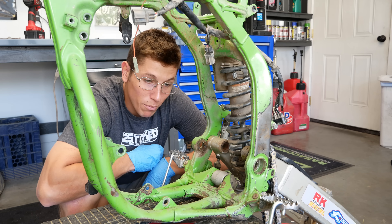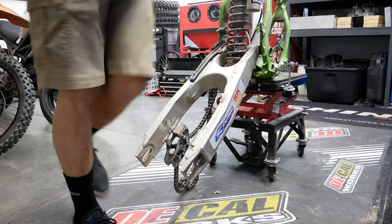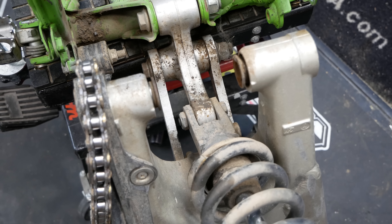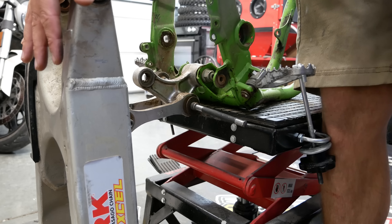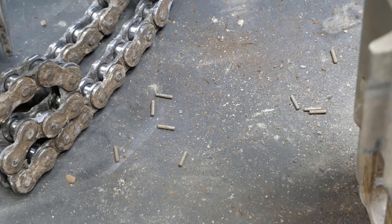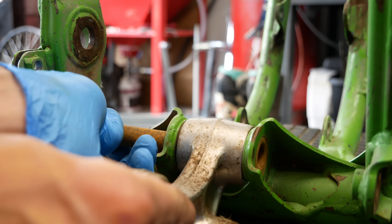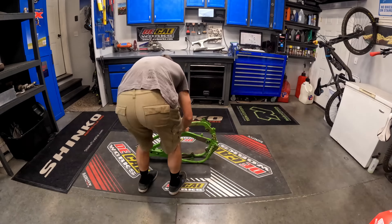I never intended to pull this motor out of the frame, but at this point I realized I was just too far along not to complete the teardown and strip the bike all the way to the frame. Despite my best efforts I couldn't get this linkage bolt to budge, and the linkage bearings were clearly disintegrating. I removed the rear shock and tried a different linkage bolt — and did get that one removed. As I was hammering it out, bearing rollers were falling all over the floor, confirming these linkage bearings absolutely need to be replaced. The bolt was gnarly and the link arm was stuck on the swing arm — for all the bikes I've worked on, this is some of the nastiest linkage I've seen.